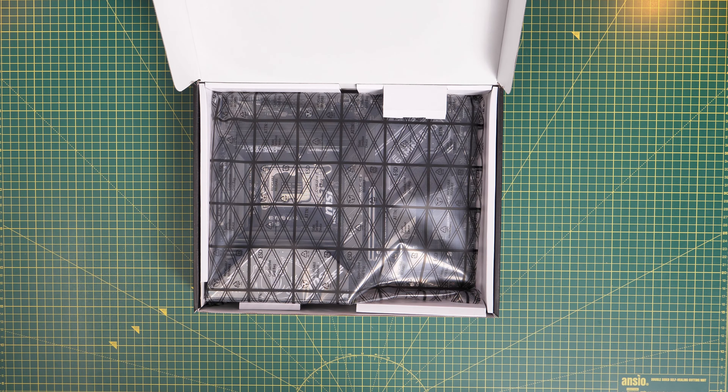If doing this on the motherboard tray outside the case, you wouldn't secure the top screws until the tray is back in. Use the tiny screws that come with the radiator to secure it down. Pay attention to fan cable direction and which way the pump head is oriented — the display is rotatable in NZXT's CAM software. This all-in-one cooler comes with pre-applied thermal paste, but I'm using Thermal Grizzly Kryonaut instead and spreading it across the CPU IHS with a small spatula.